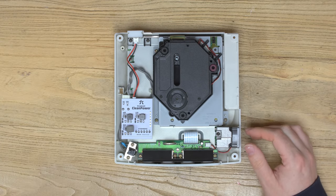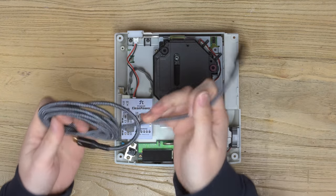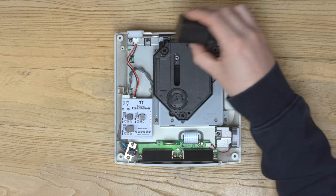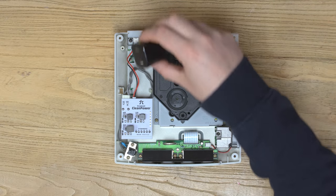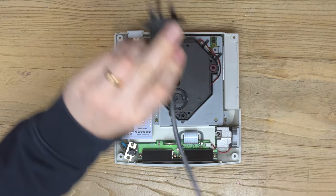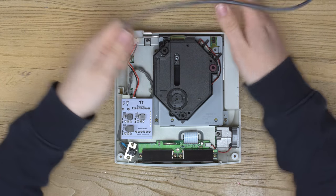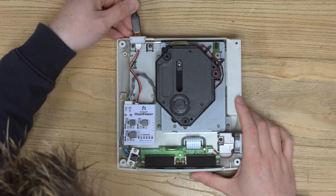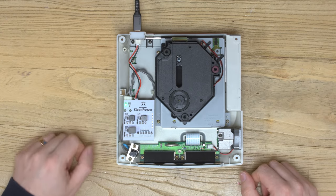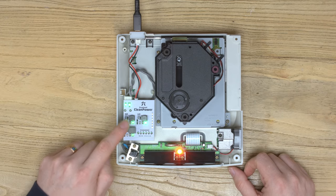Now all we need is a USB-C power supply that can handle ideally 30 watts or more, though 25 watts will work if you're really struggling. If you don't use a high quality USB-C plug, you'll find you get noise on the video rail. This can be filtered out using a filter board, however it's actually cheaper to just simply buy a clean USB-C power board in the first place. We do sell these on the store, so you can always grab them. Make sure the power switch is turned off, then connect the cable to the Dreamcast. Once the USB is plugged in you should see the USB light light up on the Clean Power. Pressing the power switch should turn all the remaining lights on, including the power input and then the three regulator outputs.